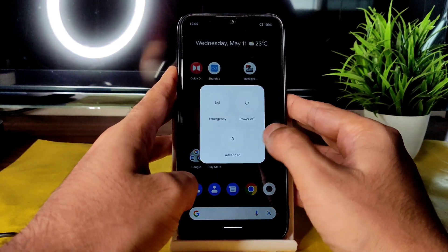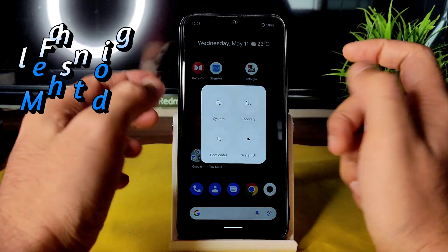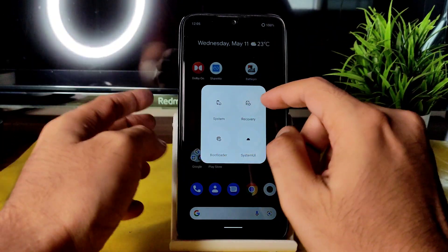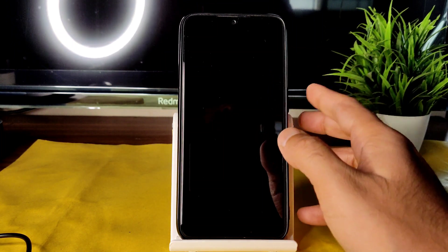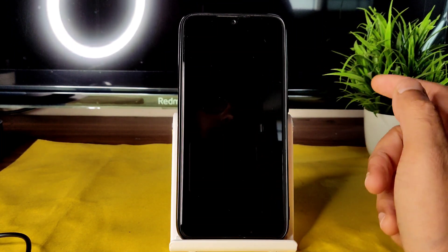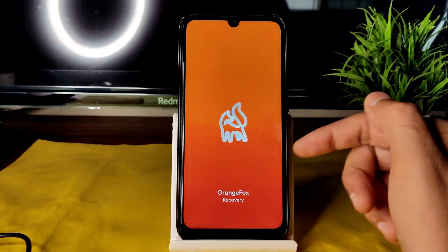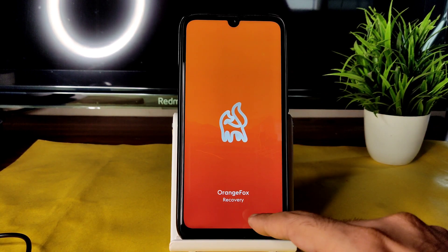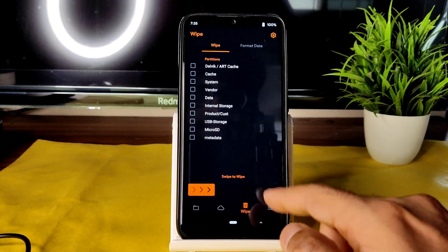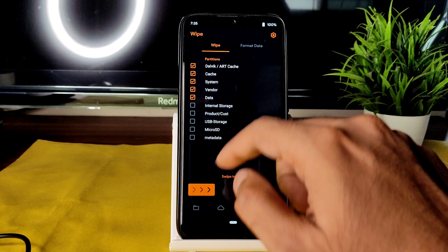Check for the advanced restart button — it's available in this ROM. This is a superior OS I recently covered on my channel. Here I'm booting into recovery. If you don't have that option, press the volume up button and power button simultaneously to boot into recovery. I'm using OrangeFox latest recovery for Redmi Note 7 Pro (violet). Once booted into recovery, go to the wipe section, select dalvik, cache, system, vendor, and data, and swipe to wipe.